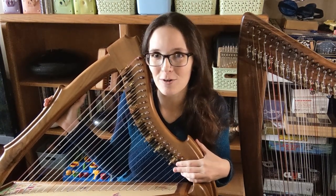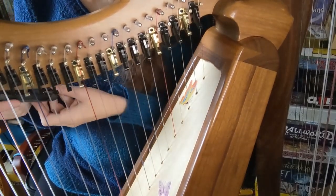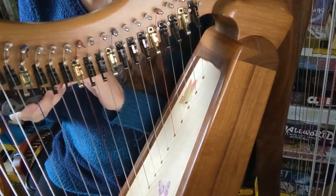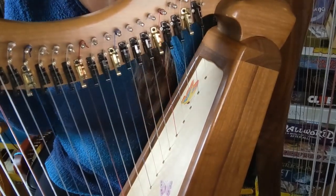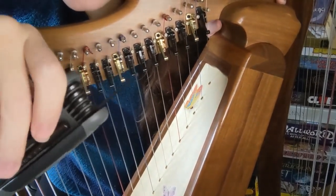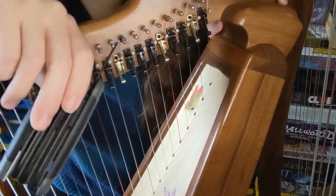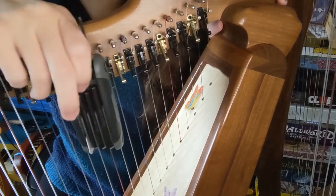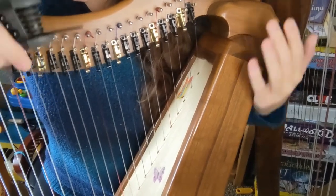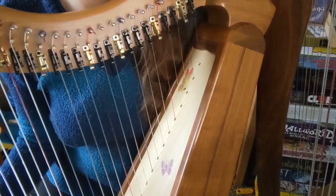The first thing you're going to need to pull this off is an allen wrench. For the universal levers — for these Rees Bridgeman levers — you use a 5/64 allen wrench, which is super tiny. You'll often see these sold individually, but my partner just happened to have a cool set. For Rees levers, what you're going to want is something called a socket wrench.